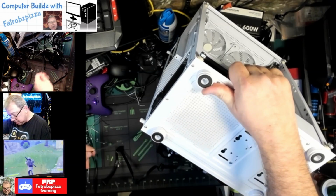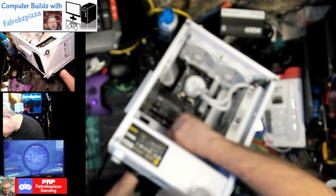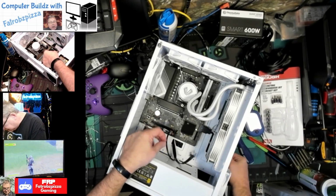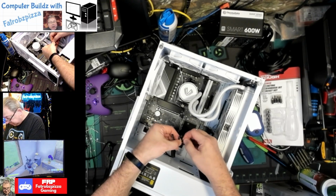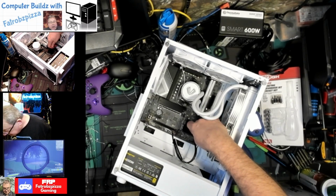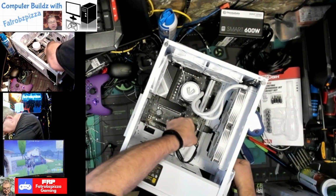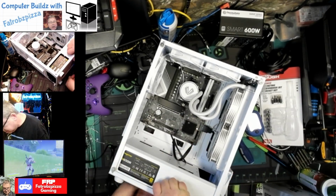So where do those cables go? Okay, here's our front panel, and there's our USB. So those are going to go in this side here. I'll feed them up. We'll pull the slack back. Okay, so USB has the one pin missing in the corner, which is on the lower side here. So I'm going to pull it nice and tight, and then front panel right here in this corner. So we have our power LEDs, which will go in the top left corner. Power switch is next, and that goes right next to it. So the HD LED will go in the bottom left, just underneath the power LED ones, and then the reset switch, there you go, and that goes underneath the power switch. There we go. So all four of those connectors are on. Pull some slack.